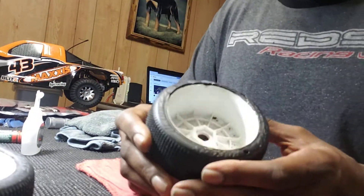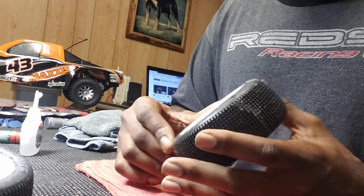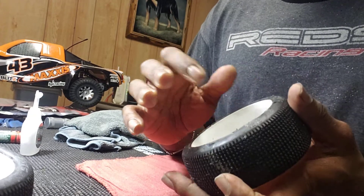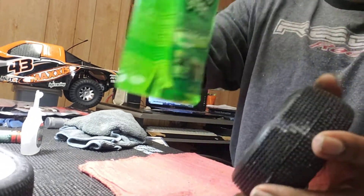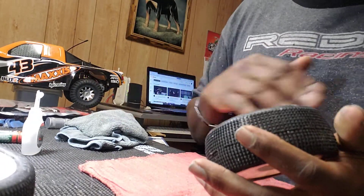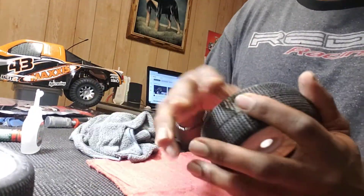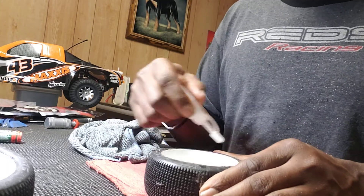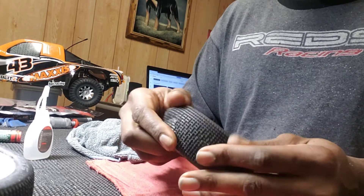You don't need to throw away a tire that came off — you just clean off the rim with your Dremel, clean off your tire bead with the Dremel, take off all the old glue from both surfaces, then spray it down with Simple Green, clean all the shavings off, get your towel, wipe it all down, make sure everything's dry, and re-glue. Once you do that you're good to go. Everything's sealed up — front side sealed up, back side glued up, just that quick.